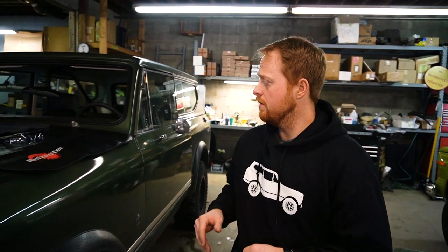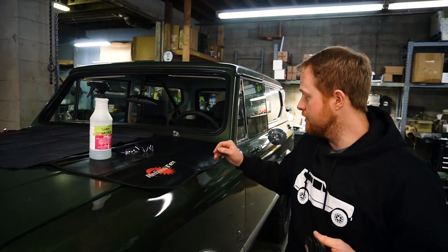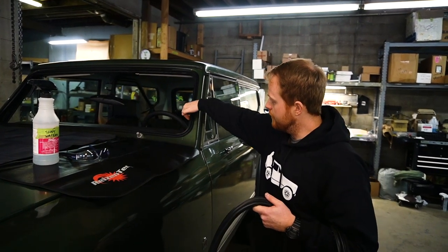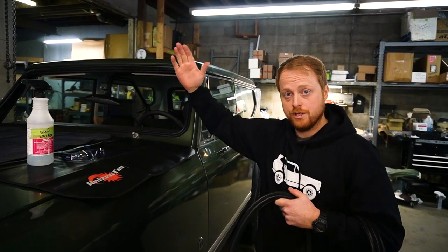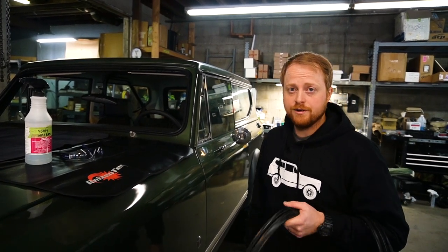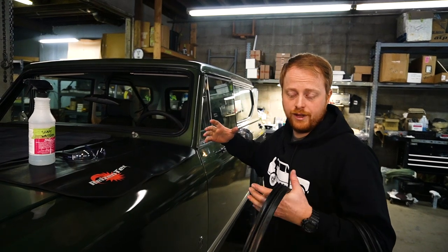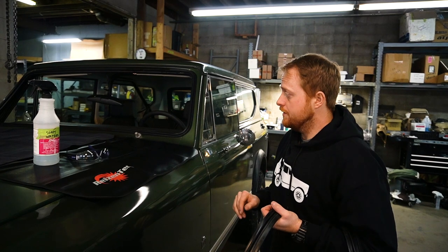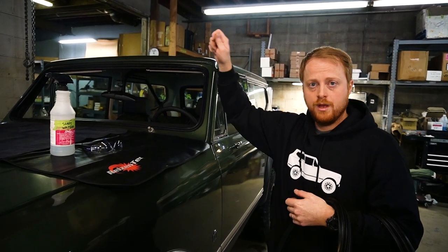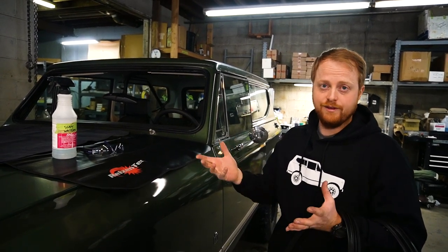We saved our old seal and just took the glass out — the reverse of what we're actually about to do. We used the locking strip built into the seal, unlocked that, folded the seal out from in front of the glass, and pushed the glass out from the inside of the truck. Definitely takes two people — not really possible to do by yourself. Most of the time you can cut the seal if you're going to replace it. Sometimes an old seal will stick to the glass and you have to loosen it up with a tool or just cut the seal — the more you cut it the easier it is to get the glass out.